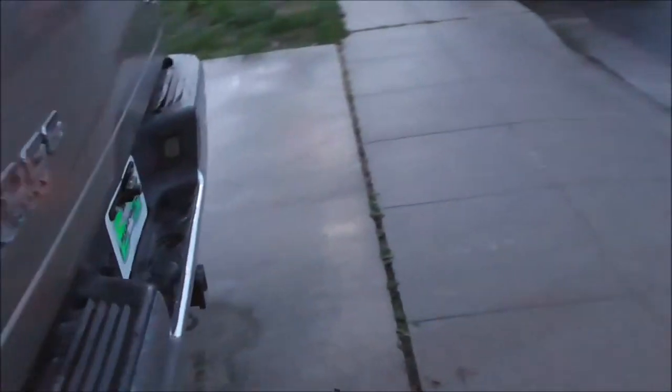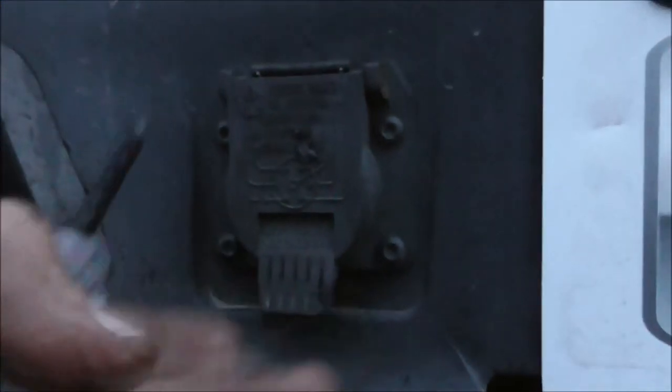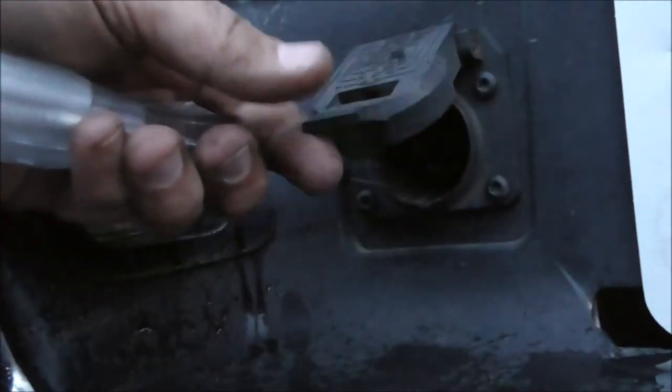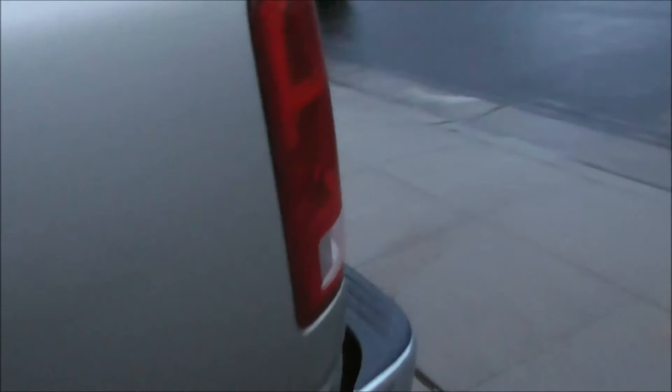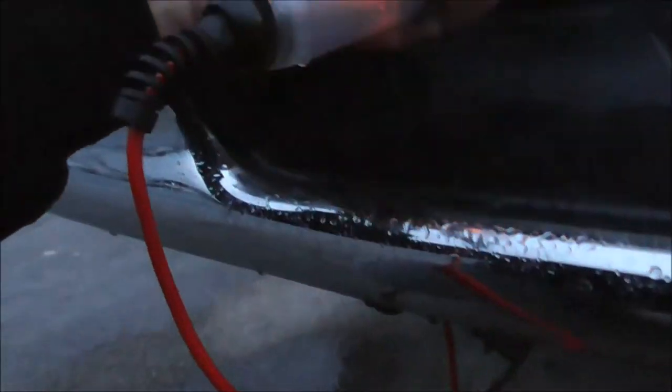Let's go take a look. I should probably turn the turn signal on — that's the one we're having the issue with. It's not too noisy back here. Left hand — let's see if I can do this. There it is — left hand turn! Let's go check the right, just to make sure. Try this on the other side — and there's the right. I got trailer lights! Cost me 20 bucks to replace those relays instead of spending 700 for a new fuse panel. It is fixable. Another video wrapped up.